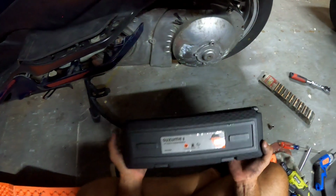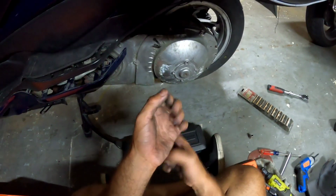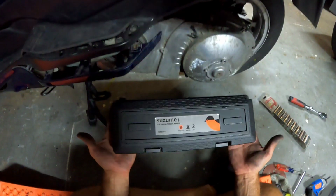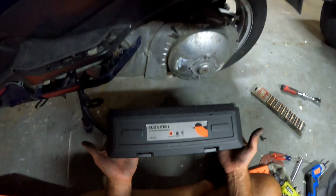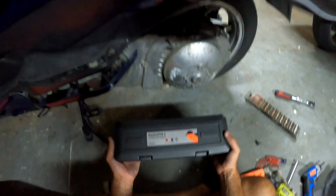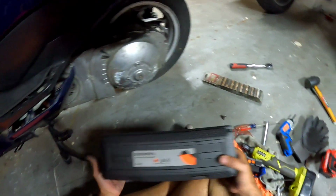It's actually much easier to use than my manual set ones, even though my manual ones are just twist a couple times and you're right where you need to go. This one you have to adjust a little bit more. I think the accuracy of this one is much, much better. I think this is a much more accurate unit. Like I said, it's within the plus or minus 2% range of being extremely accurate. So this is very, very good. Plus, like I said, capable of 100 foot-pounds. For a 3/8, that's impressive.